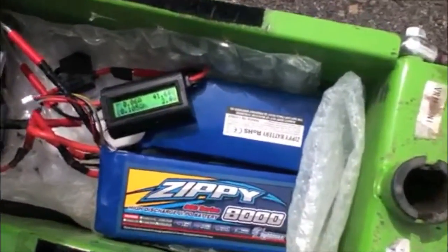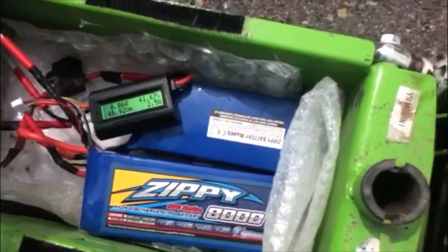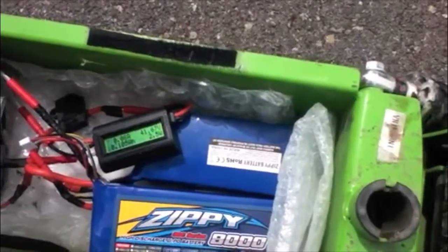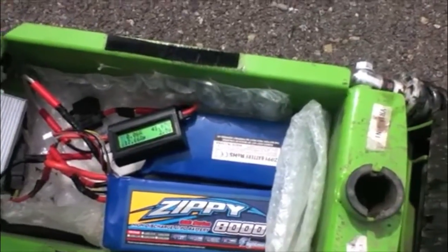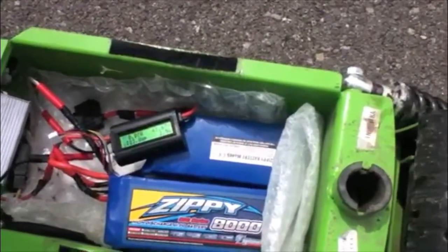You can see they've been charged up, so we're at 41.67 volts. When they're fully charged they're 42 volts exactly. This is of course a 36 volt scooter, so it was nice to see that it would actually get pushed all the way.